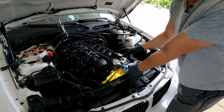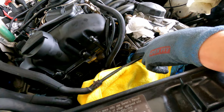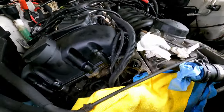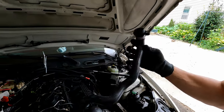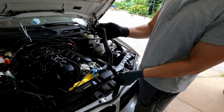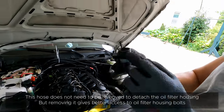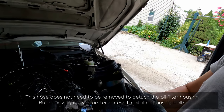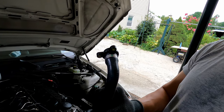When you're doing the oil filter housing gasket, you're actually looking at this orifice here. This is what the hose looks like — it's a little slinky kind of hose. This mates into your engine block by two 10-millimeter bolts. The thing about this is, if you look at it, it's plastic — typical BMW nonsense of making plastic parts, and it's not the best design.